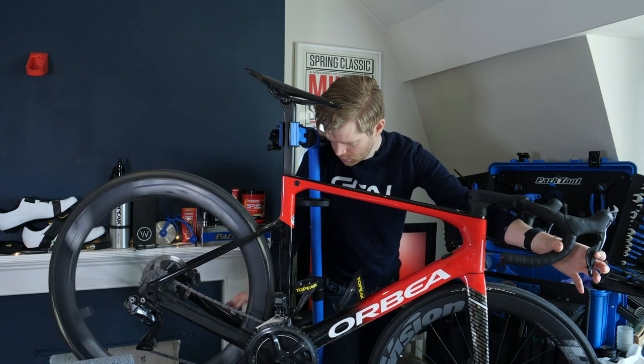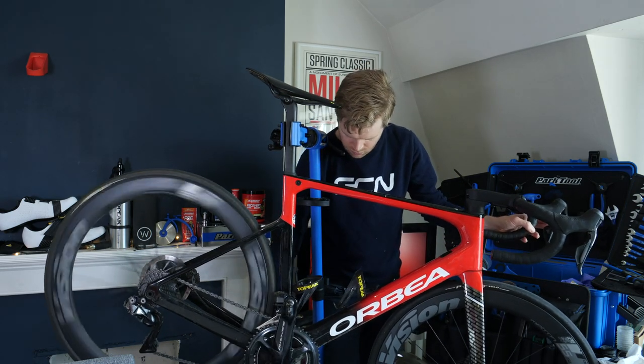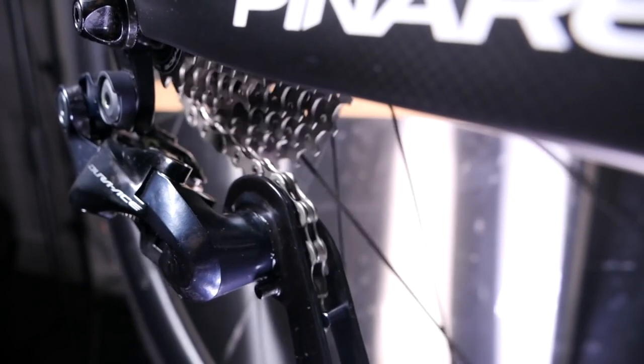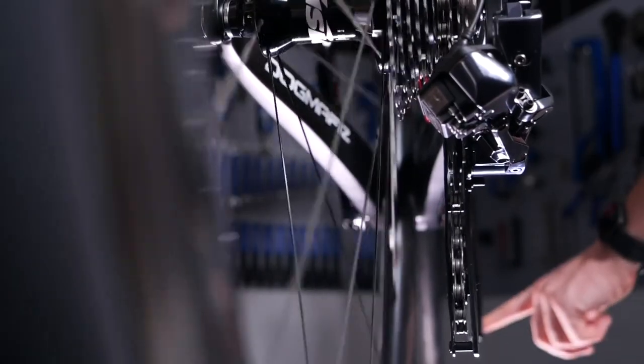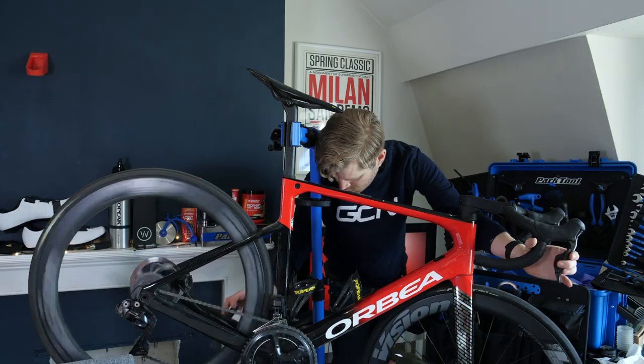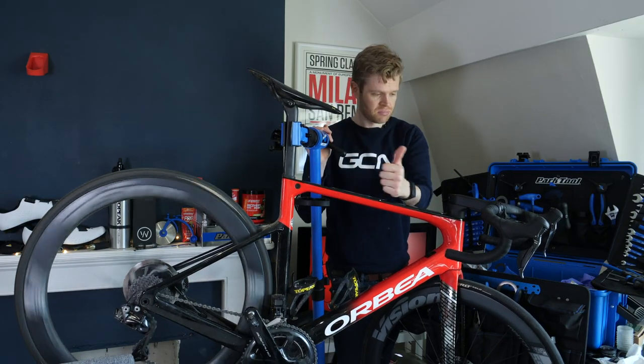Finally, you'll want to check your gears. Run through them and go all the way through the cassette to check that they're changing smoothly without skipping or jumping. You also want to make sure that when you move the rear derailleur all the way across into your biggest cog at the back — your easiest gear — it doesn't move the derailleur into the path of the spokes on the rear wheel, as this can cause a crash and break your bike. We've got a video linked in the description that can show you how to do that. You want to use a bike stand ideally, but if you don't have one, you can turn your bike upside down on a soft surface, or use your body as a bike stand.